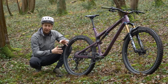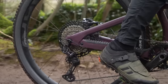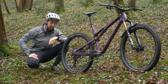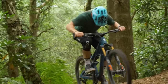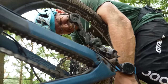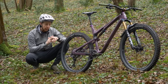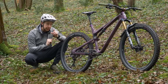Despite the fact you have an external transmission on a mountain bike, when they're working, your gears are absolutely fantastic. The problem is all it takes is a hit of a derailleur or a bit of misalignment or something not quite right, and your gears will be all over the place. We're talking gears that skip, a bit of ghost shifting perhaps — if your gear's changing when you're not even using the lever. Perhaps your gear's not coming back down the block again. It could be because your cable's clogged up with gunk, any number of things. In this video, we're going to work through each one systematically so you can trace any issues you might be having.